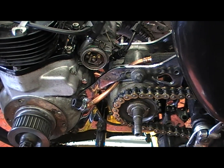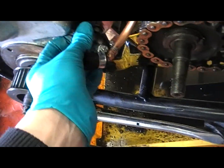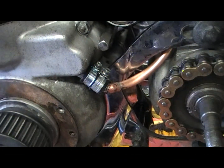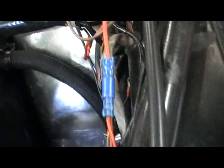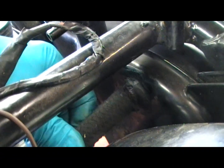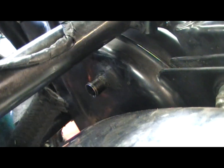Here's the bottom half of my Bunvalve system. First of all, here is the lug that I made which screws into the casing in this position, into the breather hole there. I'll just screw that in — and there's the system, all nice and secure. Copper piping, the clip on there, up through the valve, into the tank. And on the back of the oil tank there's a nice big bracket I welded on. Any oil vapour, or oil drops really, will end up in the oil tank.